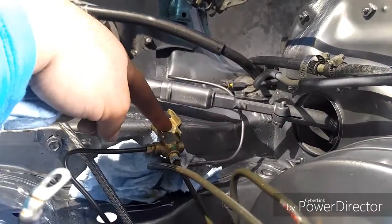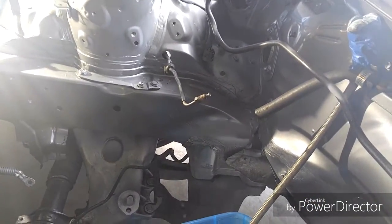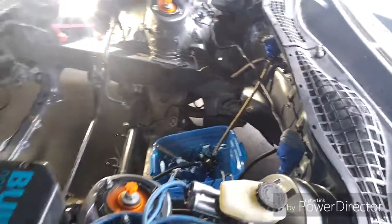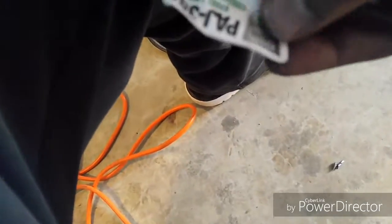I bought a 12-inch line, bent it right down to the T. I still need to cut this off with a grinder — I'm still in mock-up mode. This is the inlet, this goes to the front driver side, and the other one goes to that side where the previous brake line is. I could probably use that existing line — less work, just bend that line. The lines I have here are a 51-inch line and a 60-inch line. If you need to go to AutoZone, the part number is PAJ351 stainless steel line.